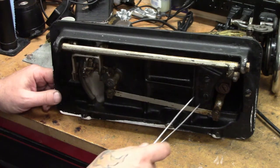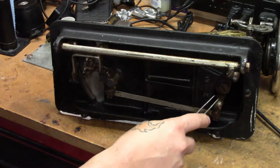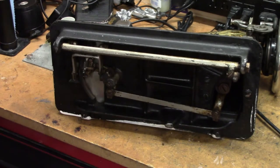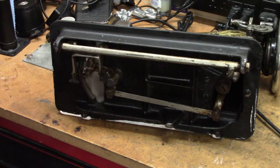So what we're going to do is take everything apart on the bottom of this machine, plus pull the stitch length adjuster out. I'm going to try to clean the Pitman that follows the crank inside in place, though I might wind up pulling that out as well. I'm going to try to avoid taking everything apart inside the needle bar area since that was already cleaned out once, though I might wind up having to take some of it out again. But anyway, that's the project today.